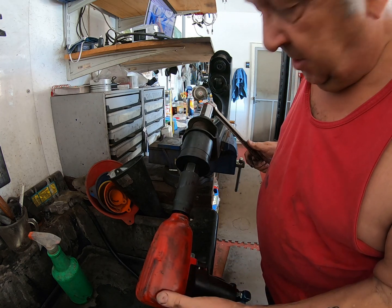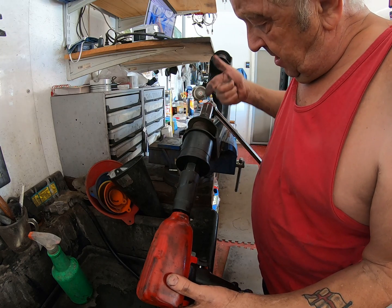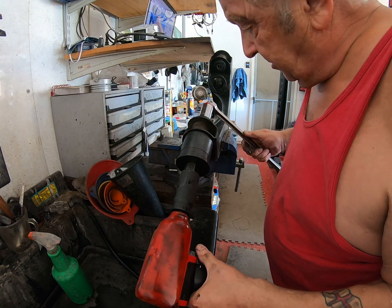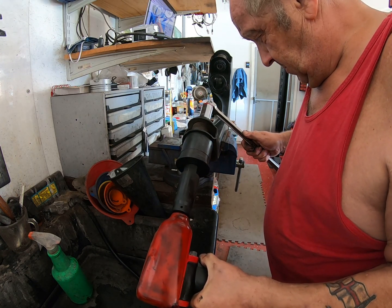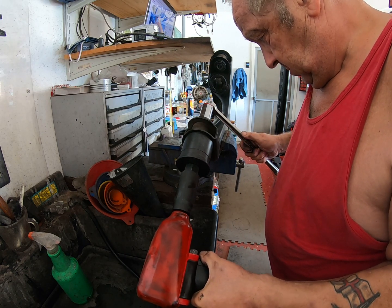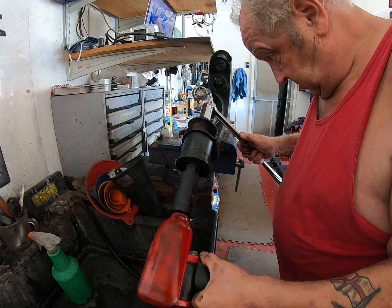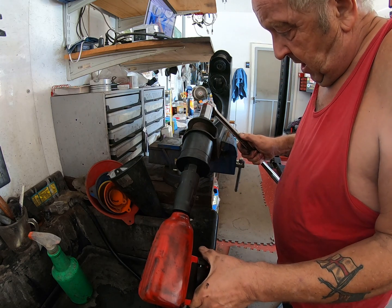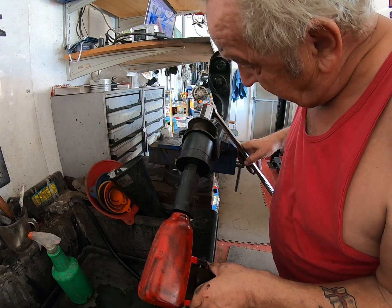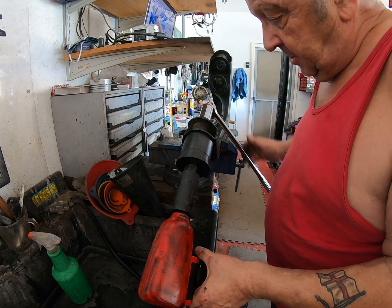Okay, we have landed, Houston. Now I can continue to do this, and that will hopefully push this sleeve, which is all that's left of the control arm bush, out. Now I know you guys didn't see it because of the angle of the camera, the angle of the dangle and the dingle of this Pringle, but I suddenly saw the sleeve move, so now I'm going to take this off.